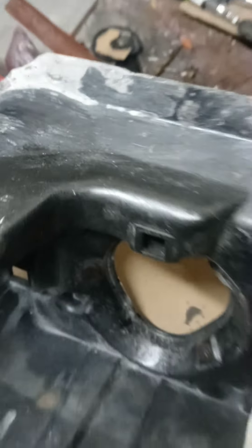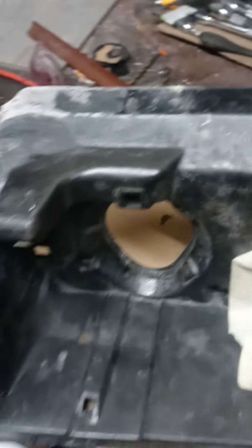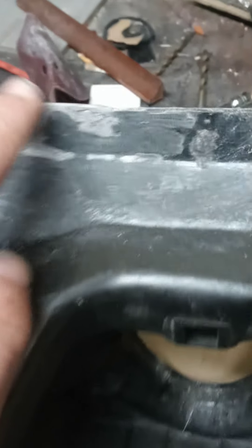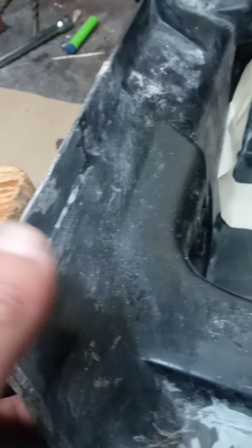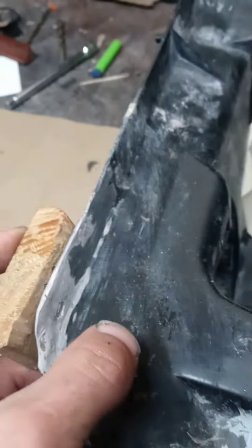When I used the fiberglass filler, I could literally just do like this and it would come off. I used the fiberglass filler with bondo hardener, mixed it up and it was kind of like a reddish green. What I did to test it out - I built this section right here, put like a layer right here, let that dry, and then took some cardboard and pressed it against the backside. Used my little yellow spreader thing and layered it like that.